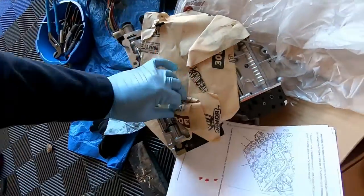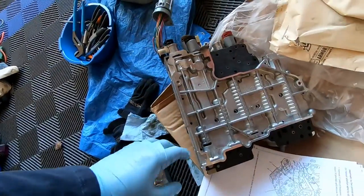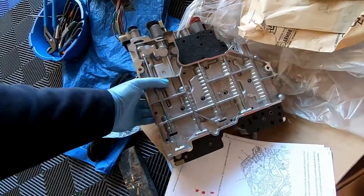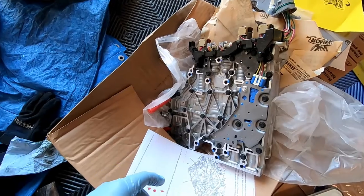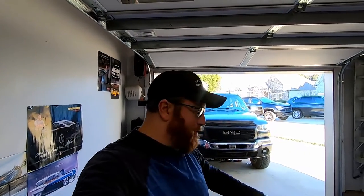Here's the flip side - this is what goes up against the bottom of the transmission. Nothing too complex here. We do have to feed the wiring through the transmission case. One more thing: the bolt pattern didn't exactly match the diagrams that came with the Duramax Tuner kit, so I ended up just taking out all of the bolts coming out of the valve body - there's probably like 20 of them. I think you only need to take off like 15 of them, but I just ended up taking them all out. That was the simplest way not to lose track of which bolt goes where. Now that we've got the old one out, we'll put the new one in.